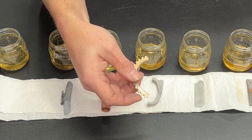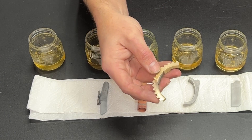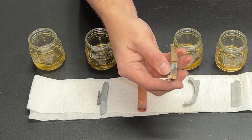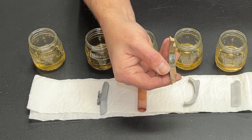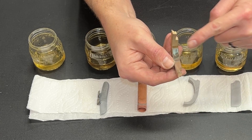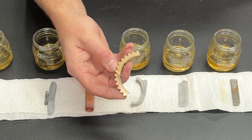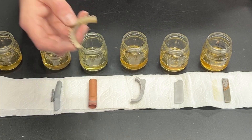The brass I found very interesting because the copper and zinc both didn't fare well individually, yet look at the polished area on the brass — it's still relatively shiny. The etching was very, very minimal. Had it been fully submerged, I don't think we'd have seen much difference. There is an oxidization band at the line where it was out of the liquid, but the polished side is pretty smooth all the way across. Brass fares fairly well in Pine Sol as long as it is fully submerged.